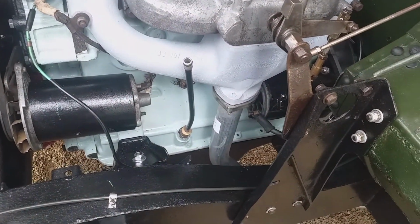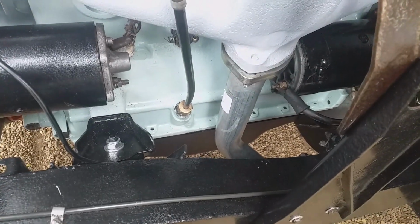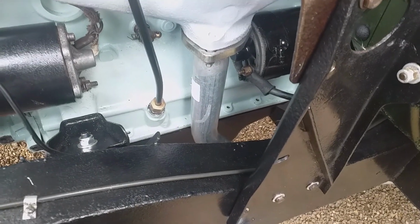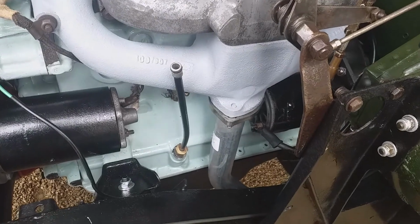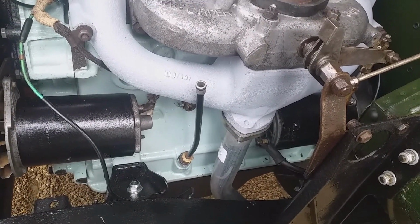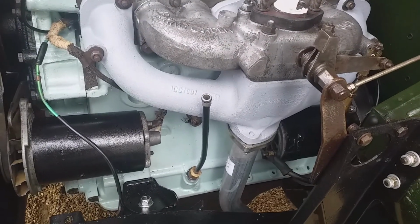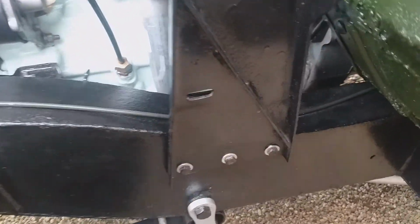Anyway, so I used part number 517632, which is specifically for a 109, the long model, and that's a petrol exhaust for 1961 onwards. I don't know where that stops, but this is 1961 onwards, and it went in real nice and easy. That was Brit part number 517632.